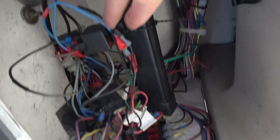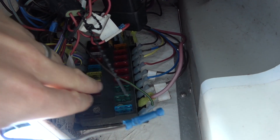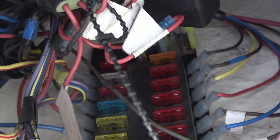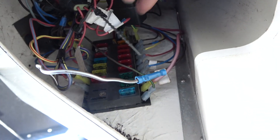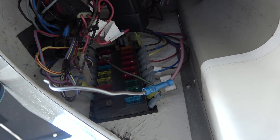So this is all the wiring now with the new relay. We weren't sure where the feed was coming from - there are a few brown with green wires. This one is brown and green coming from the top left, third one down, but there was a 30-amp fuse in it and the manual says it should be a 10-amp fuse. So we've taken the 30 out and put a 10-amp in, making a note it used to be 30 - maybe they changed it to power something else. If you do the horn now - Brian will do the horn - you can hear it. If I take out that third fuse and do it again, there's nothing. Pop it back in - there we go.